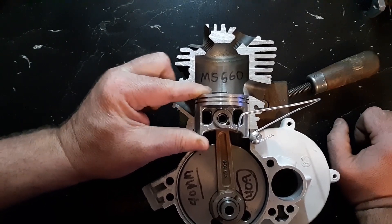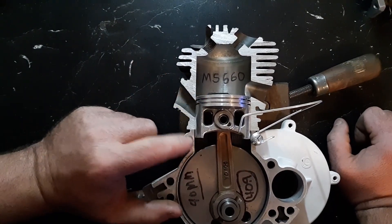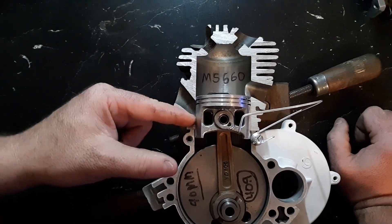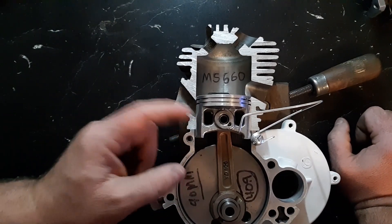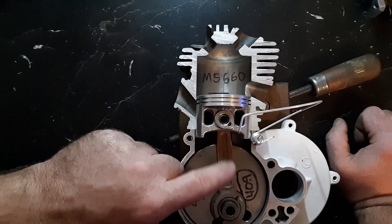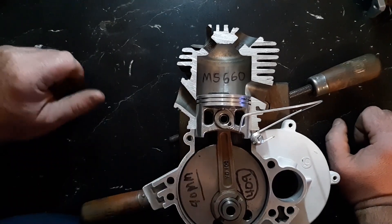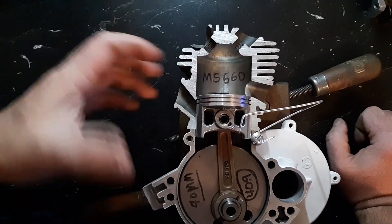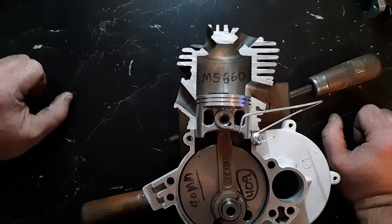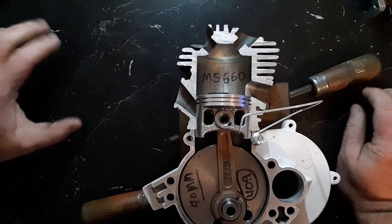If you hear it moving in there, that's going to cause piston ring slap. The fact that most people are going to cut another 4mm off means even more piston is hanging out. I'll do a video of an extreme example — I'm going to put a tiny rod on this just so you can see what I was talking about regarding piston ring.